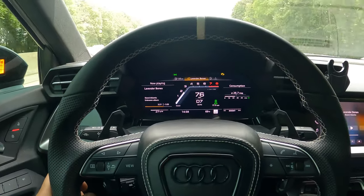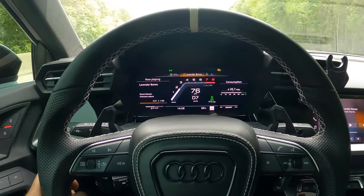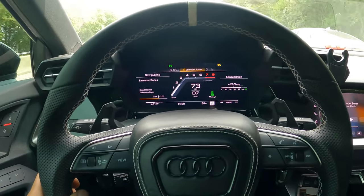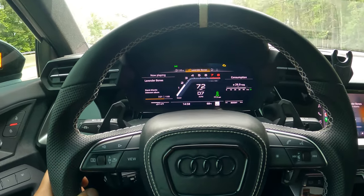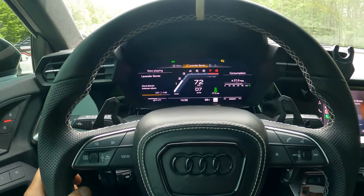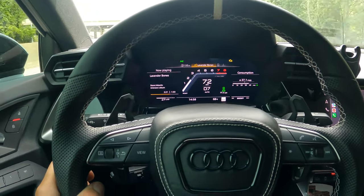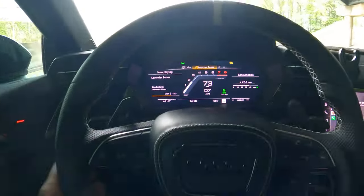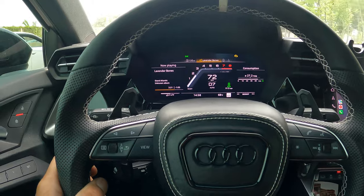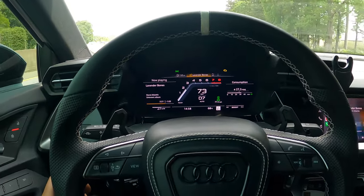I don't have the resources to do that. So I put the red ones back in, the 034s, and again I feel like I felt a difference. The biggest variable there is probably the placebo effect. But the biggest actual variable is that the OEM coil packs have 26,000 miles on them, so they could be a little tired. The book calls for like 40,000, so I'm at damn near 75% of its life. I really do feel it in this car, so maybe it was just time to put new plugs in or new coil packs in.